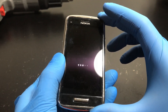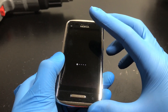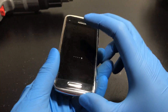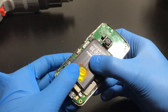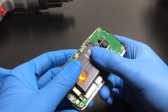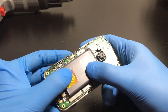Still doing the same thing — I tried it a couple more times off-camera with the heat gun and it's not working. I'm going to clean up the USB port a bit more off-camera and then try plugging it into the computer. If that doesn't work, that's about it for this phone. The reset combos won't work, nothing works. To do a proper repair like this, I'm pretty sure you need level-three experience, and I just don't have all the tools necessary.